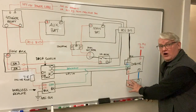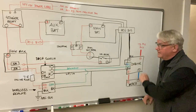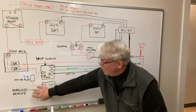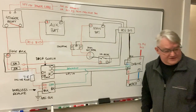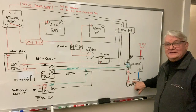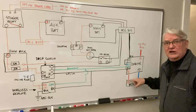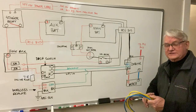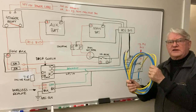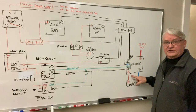The four components are the winch itself, the contactor (which is like a big relay), the dashboard switch, and the wireless remote. The winch has a positive and a negative color-coded yellow and blue — I didn't have a yellow marker so I'm showing it as red. There are a couple of heavy cables, maybe four-gauge or five-gauge, that you're going to connect from the winch to the contactor.